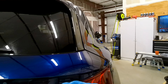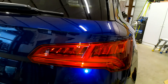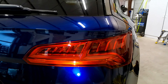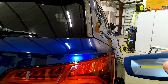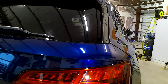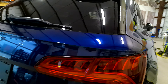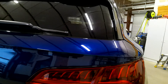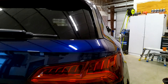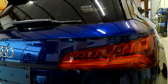Check our work. For a one-step, that is awesome. There's still some there, but it's not a whole terrible lot. We aren't aiming for perfect — we are just aiming for polished and clear. This stuff will all come out when I do the alcohol wipe when prepping for the coating. We are good to go for this car. That's polishing and correcting taillights on a one-step correction. On other cars where we do a two-step or multi-stage in the future, we will do a multi-step correction on the taillight where we are chasing actual perfection in the lens. Make sure y'all like and subscribe. I'm going to get back to work finishing this. See y'all next video — Junction Auto, out.